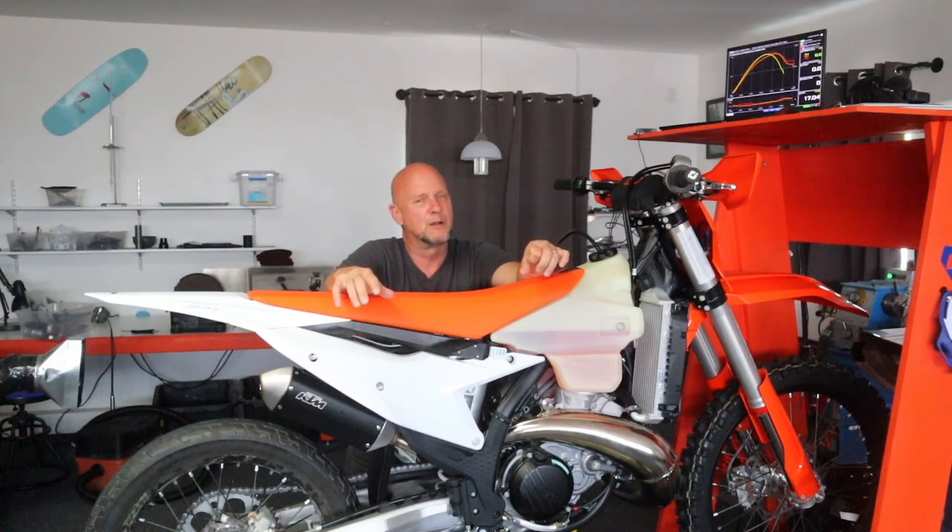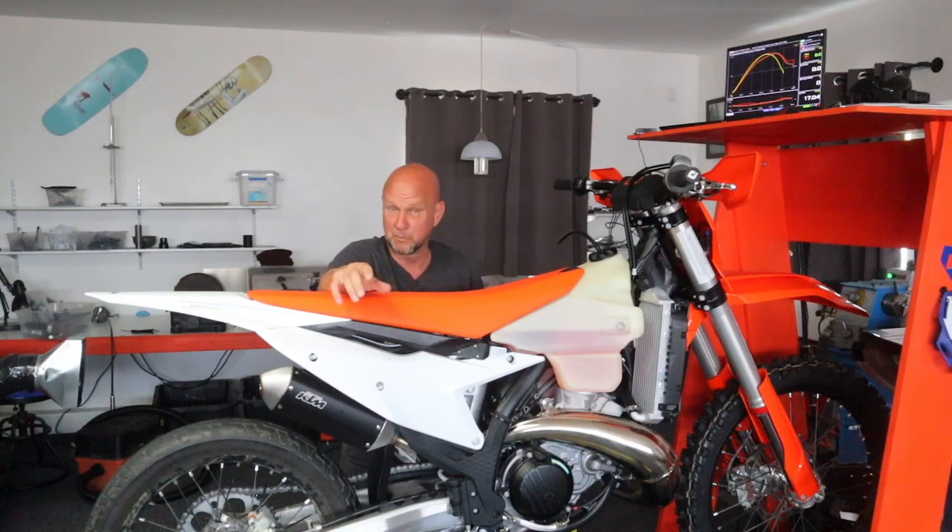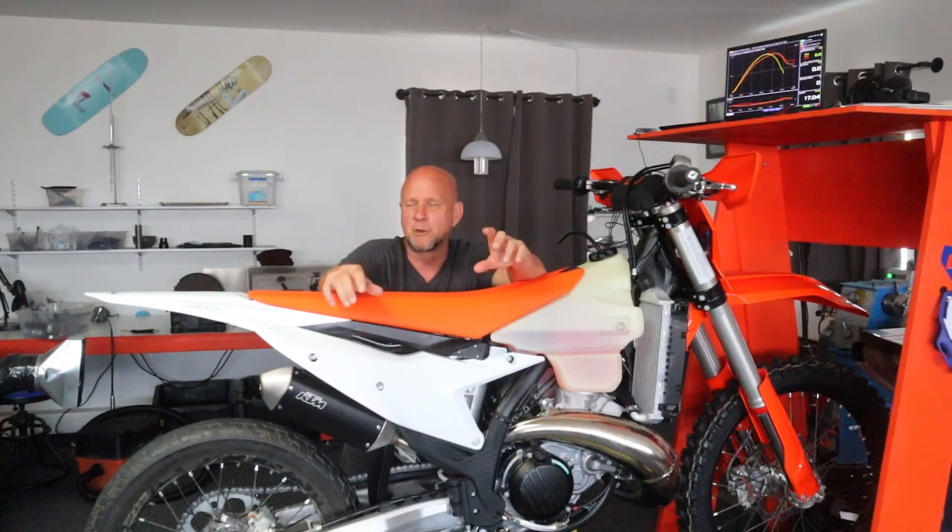Also the Pin It Racing thing. Now, this is the only video that's going to be done on my 2023 300 XC, the new TBI bike. You want to know how much power it makes or doesn't make. Let's run it and compare it to the 2022 300 TPI bike, completely stock, and then throw in the mix what we call the new power bundle kit with the injector relocation block, which basically makes it like this by taking the injectors out of the cylinder and getting them into the throttle body area with the ECU reflash.